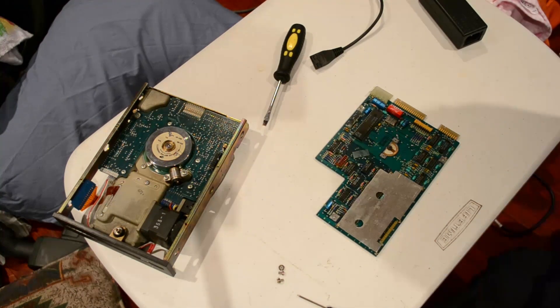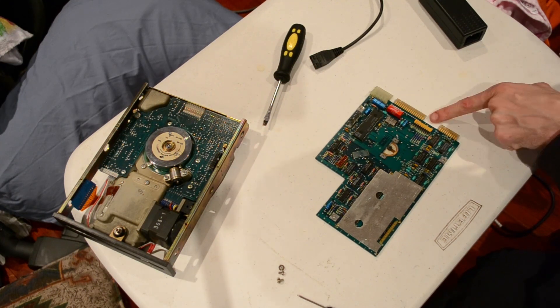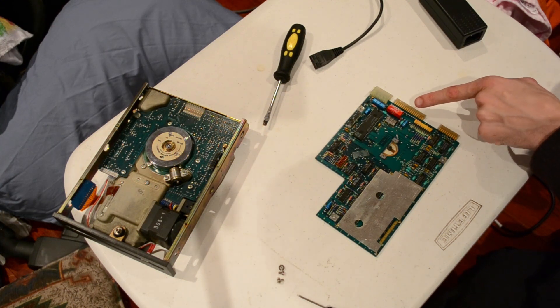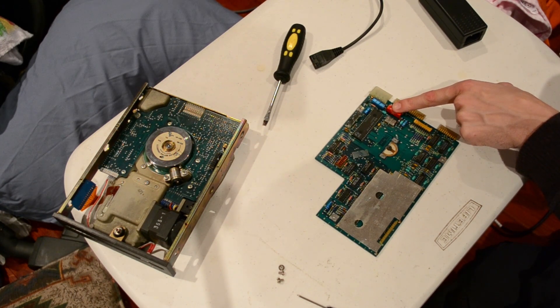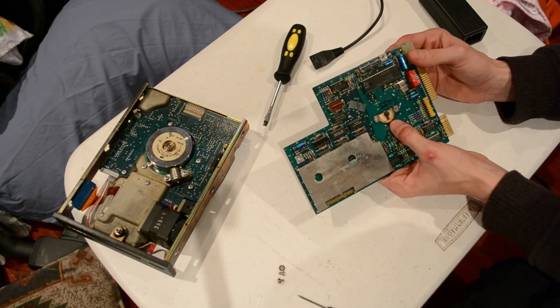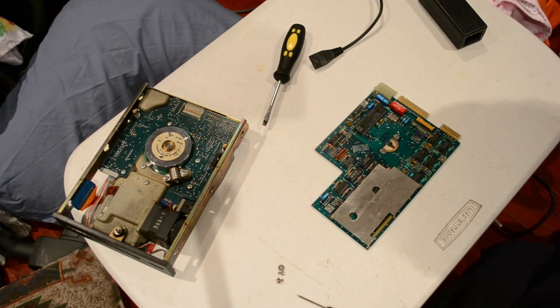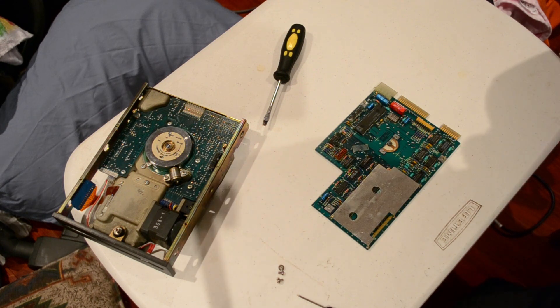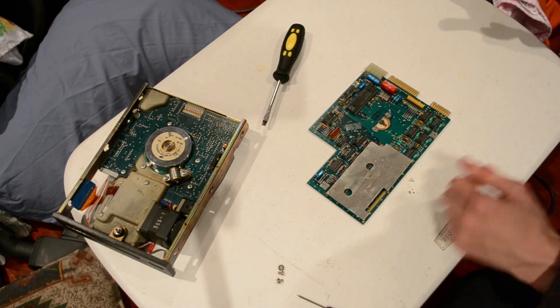This is the main logic board, and the fact it's got more chips than an IDE drive — it's actually quite stupid. Here's your terminator, like SCSI, to stop signals reflecting up and down the wire. Switch block to let you configure which drive select it responds to — whether it be 0, 1, 2, or 3. This is an interesting thing you don't see on modern drives: a little grounding brush. It stops the platters picking up a static charge and making a mess of things. Back then it used to get a bit of a static charge, which makes sense — the motors were a lot bigger.